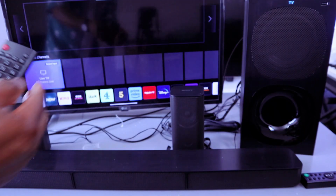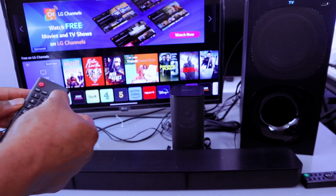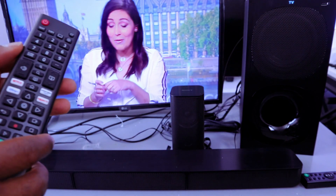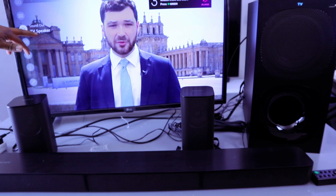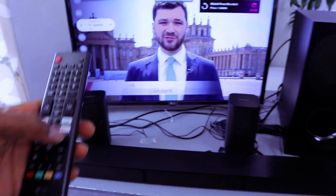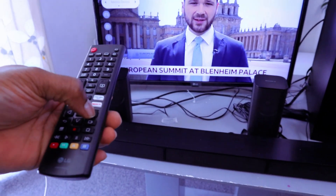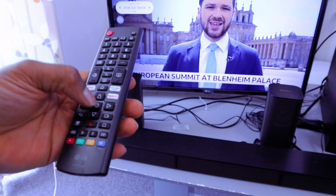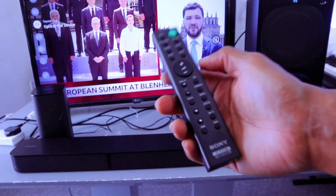Switch the TV on. Then go to your TV settings — use the gear button to select TV settings. Scroll down to sound. If you look at sound, it's showing TV speaker. Select sound, then scroll to the side to optical. Select optical, our device — it's connected.